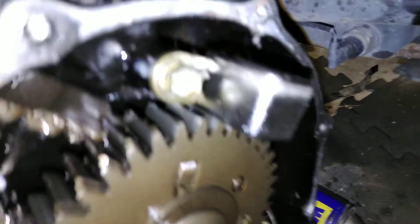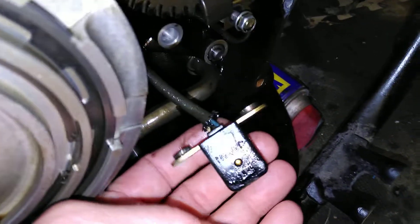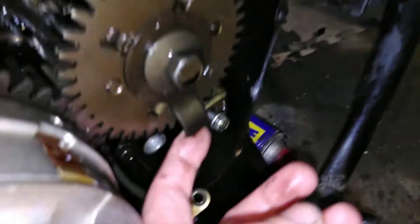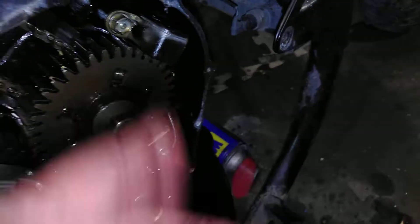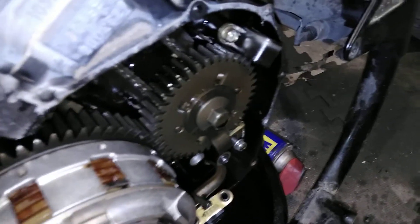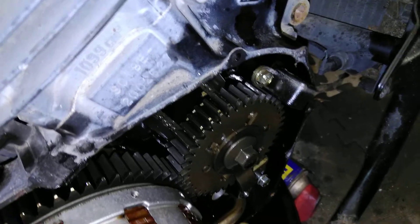The yellow wire is tied to the top pulsar right here, and the bottom one — which I have unbolted — is an open-circuit pulsar. I've got a new part ordered for that. This piece of metal comes around and triggers the pulsar, which tells the ignition module that the crankshaft is at the top of its stroke and the piston is at top dead center.